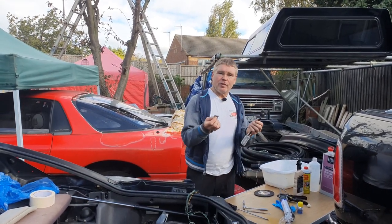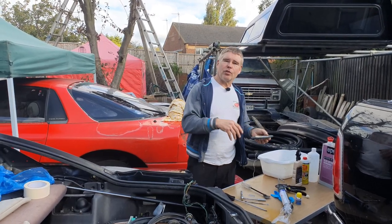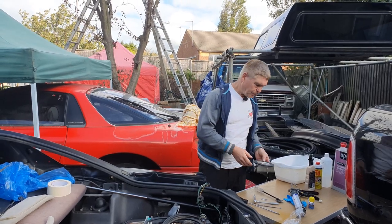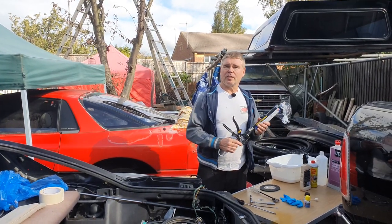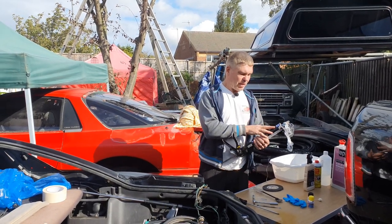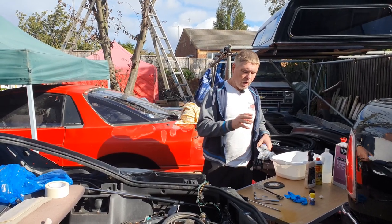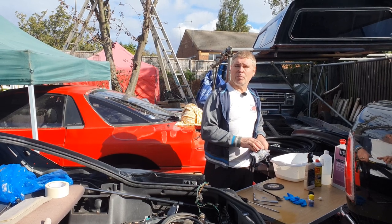A couple of blades to clean the old muck off the old glass. Depending on whether you've resprayed the panel or purely took it off to do the glass, you're going to need some double-sided foam sticky tape for re-sticking the rubber trims. In order to fit the glass you're going to need some specialist urethane sealant. This particular make is Dinitrol — I got this off eBay. It's enough to do both glass panels and cost me about 25 pounds with all the related chemicals. I'm not endorsing it — it's the first time I've used it, but the brand is pretty well known.